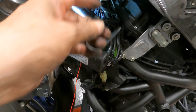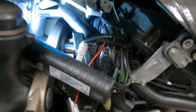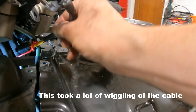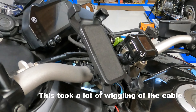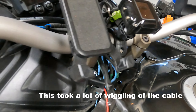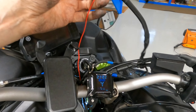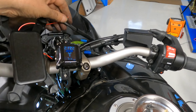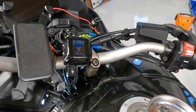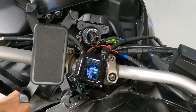I actually pushed the cable back out through the hole and then loosened it, so now we can get it. I pulled it up and pulled the cable up. I've tied the wire onto the new cable so we can feed it through and it will follow the same path. I'm holding the camera with one hand while the other hand has the original cable.